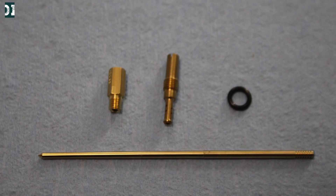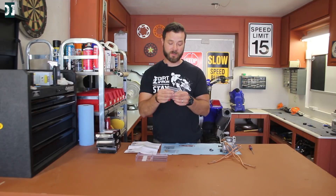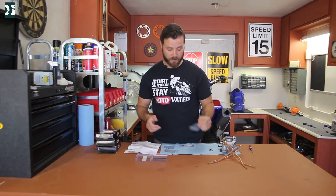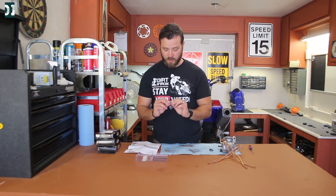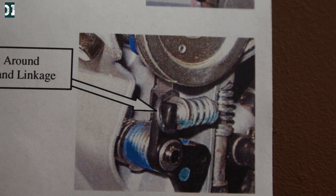So we're gonna do that today. We're gonna do the pilot jet, we're gonna do the main jet, and we're gonna do the custom needles — they do their own needles, which is really something great for your bike. It's a really nice transition when you go on the gas; you don't feel that hesitation when you're going from low RPM to mid range and to high RPM. I really like these needles. And the last thing we're gonna do is this O-ring that goes on the accelerator pump, which also helps a lot with throttle response.